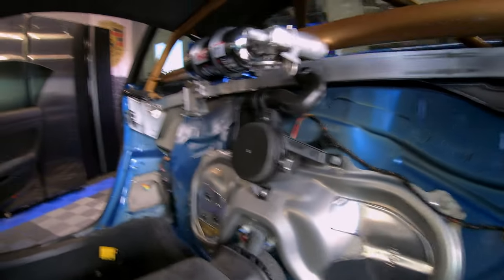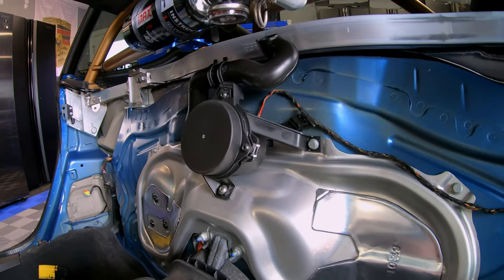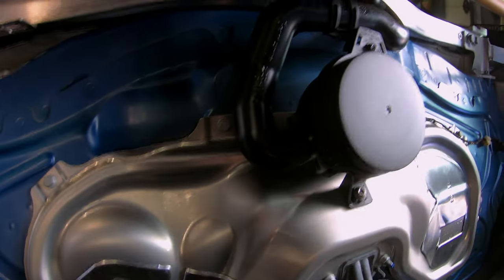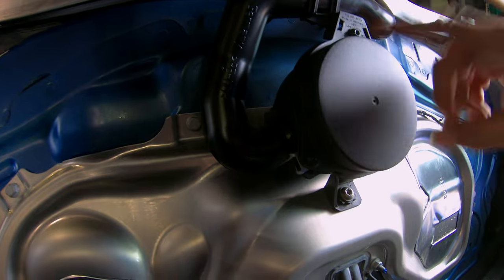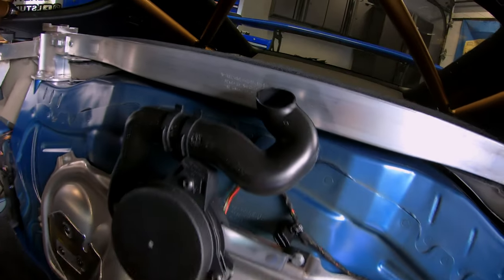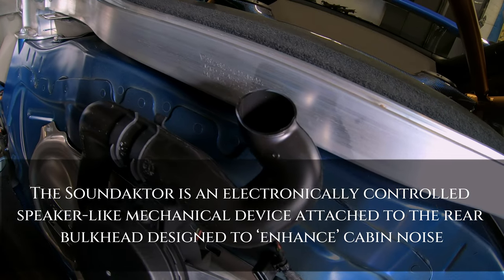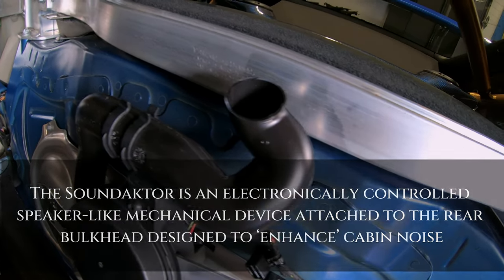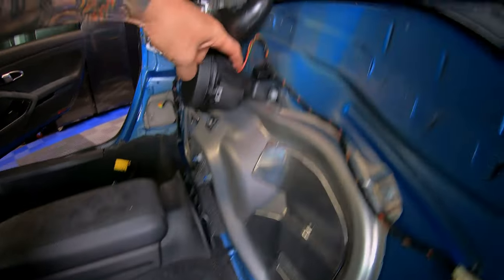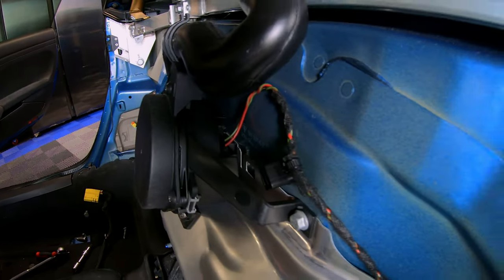And guys, is that the sound indicator that we're all talking about disconnecting? Because I know I disconnected mine from the fuse in the back, but I'm wondering. If you look at it, it is, because here's a tubing. So I'm guessing that's the speaker. Yeah, that's the sound indicator, because look, there's the port. And right there, guys. I don't know if anybody knew that. Basically it makes that sound and puts it into the cabin here with us. So mine's disconnected. As far as disconnecting it in the future, if nobody wants to pull fuses, you can actually just disconnect it from the back, I think. Hopefully it doesn't throw an engine code.